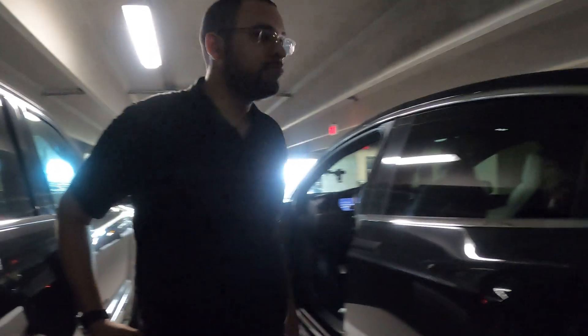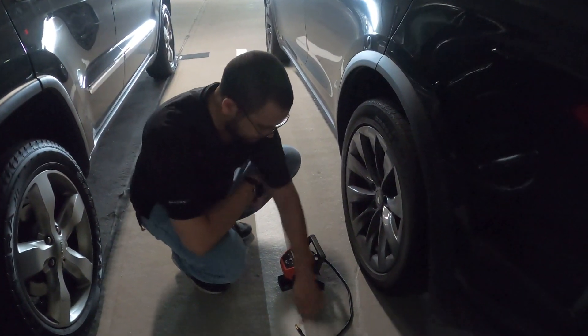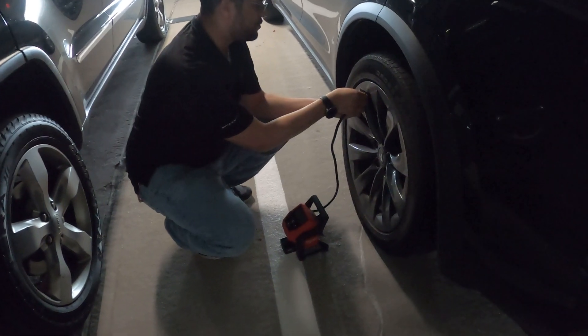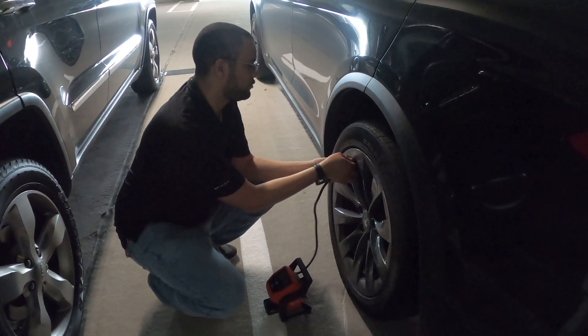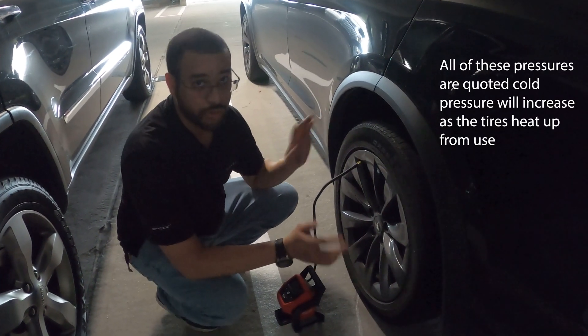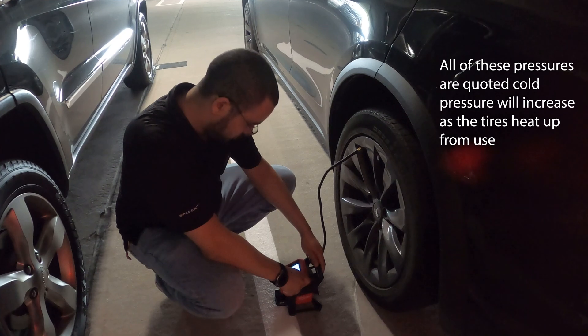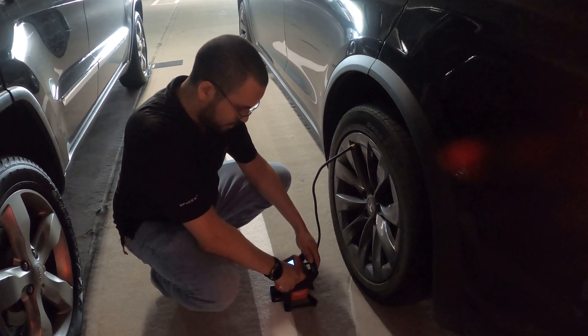I locate the placard for the car — on this car they are 45 PSI front and rear. I don't actually run that pressure; I run it a little higher because I like a stiffer ride and for my tires to last a little bit longer. If you want to keep your tire warranty, you don't ever want to exceed what's printed on the tire — in this case it's 51 PSI. I'm running it to get 46.5.